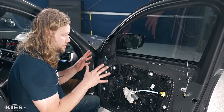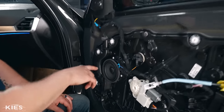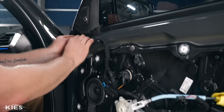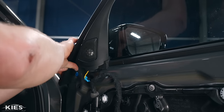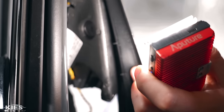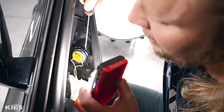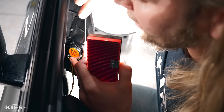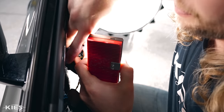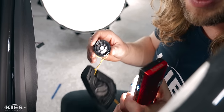Looking at the inside of a door with Harman speakers, you'll see a tweeter up here and a mid-range down here. Whenever you're dealing with speakers, don't touch the cone — it's not good for the speaker. We're going to start up high: disconnect the little blue connector, rock this down, and with a gentle pry we can see the piece of foam and then the actual speaker. The tweeter is held in with little clips, so take a pick or trim tool and press one of those clips to release it.